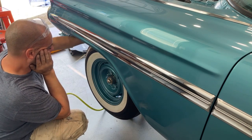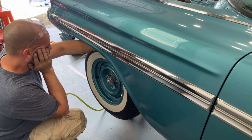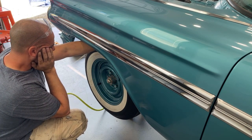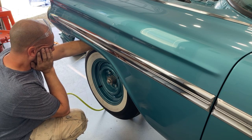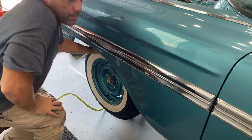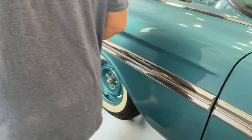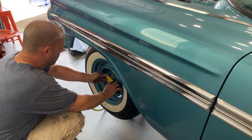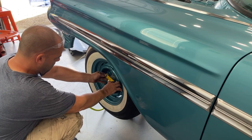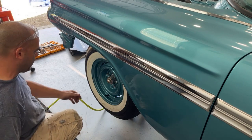So for now, I can just tighten them up. Just won't be able to drive them like that. We're gonna have to find two more rims with the 4 5/8 bolt pattern. Because when I measure, or am I wrong here? Unless this one rim is different. Measure from center to center. And the other three rims are 4.5. And then the rears are 4.5 on the car. That's 4.5. Is this one rim wrong? I think I have one rim that's 4 3/4.